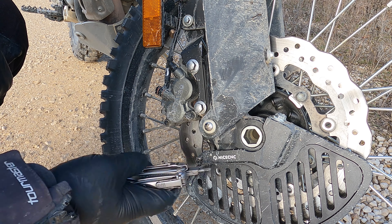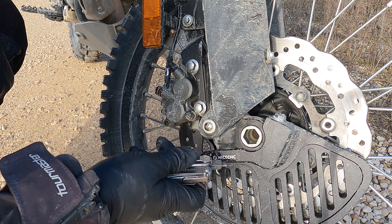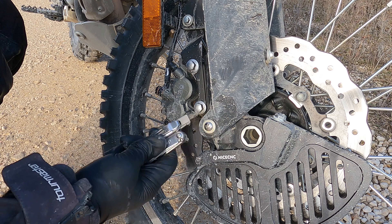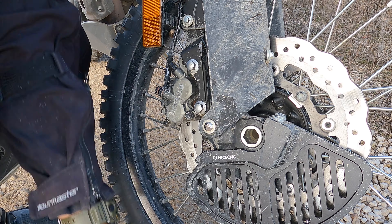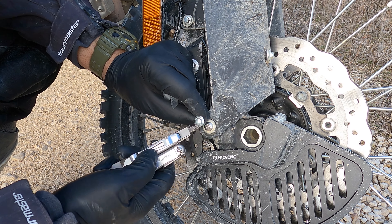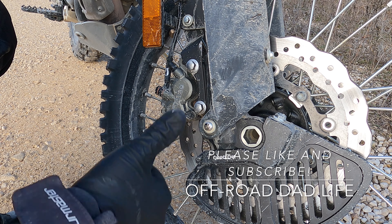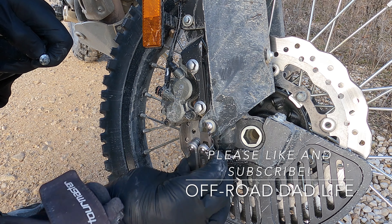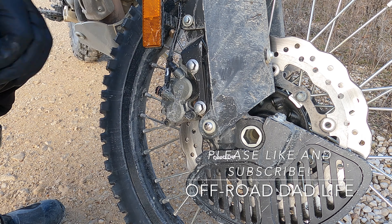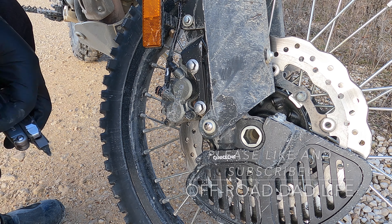You still have the issue of this plastic right here, but this plastic will give — it's not going to be like striking metal to rock. As you can see, when hitting this, it's working itself off that pan head rather than having a square edge to catch. So this will be my little solution. Take it for what it's worth. Maybe subscribe and throw a like down there — I'll be coming up with other ideas. We're creating a glancing surface rather than a striking surface by putting this one dollar bolt in. Hope this helps. This is Josh, Off-Road Dad Life — y'all ride safe.